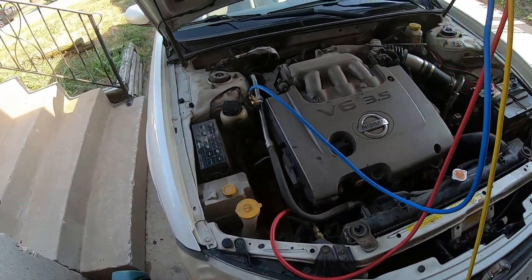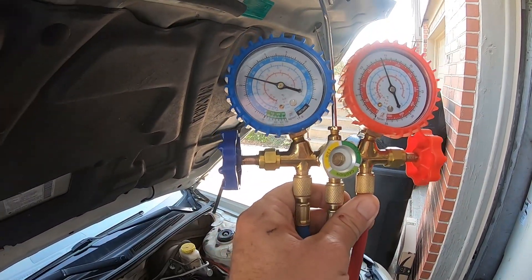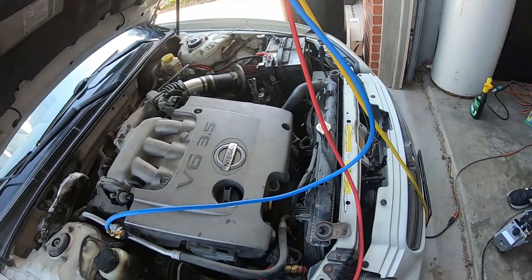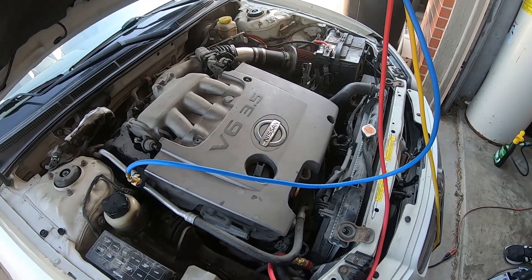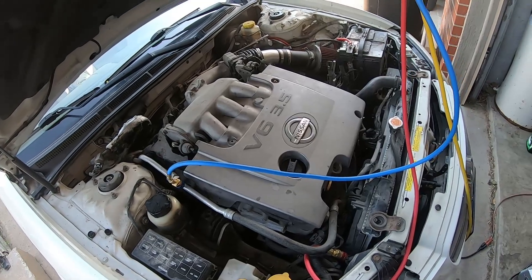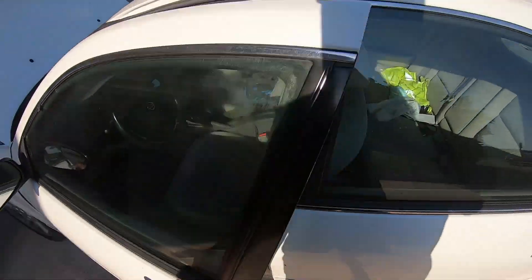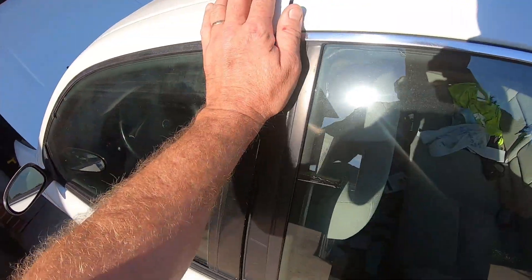After getting one and basically one and a half cans of Freon in it, pressures are good — high side pressure is just a tick under 200, low side is sitting at 34 to 35. I only had a kitchen scale to measure ounces from each can, so I guessed on half a can of the second one. That should be about 18 ounces total in the system. Right now it's blowing cold, which it obviously wasn't doing before.